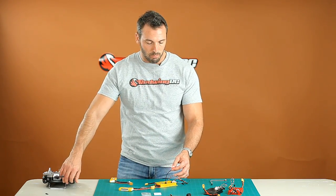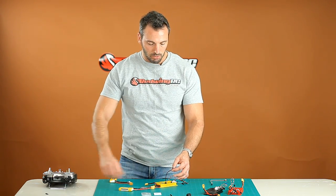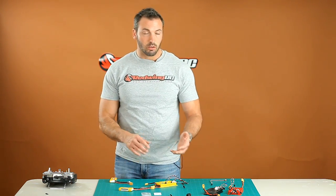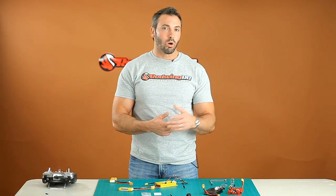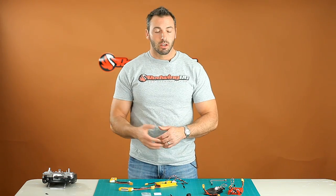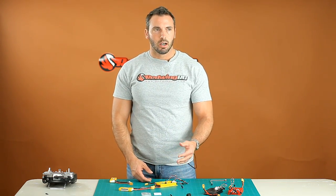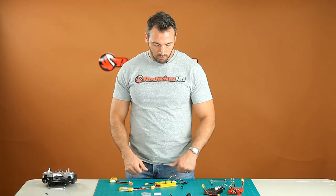So again, you can see as I flip my gear switch off and on, that'll light up along with that. So again, to use that, you'd need to not only buy the LED, but you'd also need a Y, so you can run one of the outputs to your ignition and the other one to the LED just as a display. And these LEDs, I think, run anywhere from like 3 volts to 12 volts, so anything you're outputting to them, they'll work on.